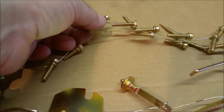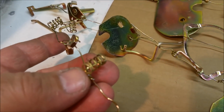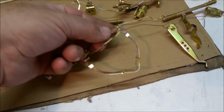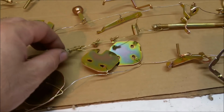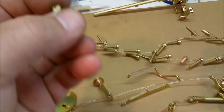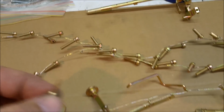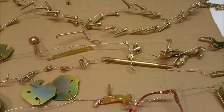That would have been because that was on the top and the other one would have been mounted sort of underneath the carby, holding the throttle body on. Same with the mixture screws, they're all lovely, except one looks a bit dull. That might not be mixture, that might be one of the idles or something like that. The linkages all look good, the choke cable bits, or the choke housing bits I should say. The mixture screw, I saw a mixture screw somewhere, there's one there, there was a free one. What the heck did I do with it? Oh, there it is. And that looked lovely, particularly the important part around here is perfect. So we'll untile this stuff and stick it in a box, and then we can start putting the thing together.